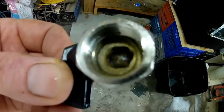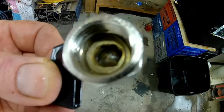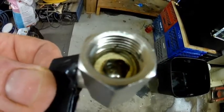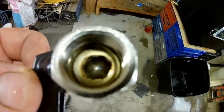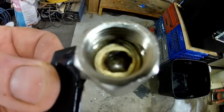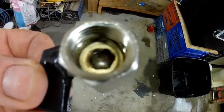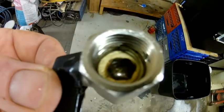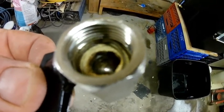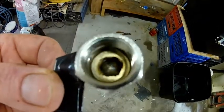And that's because of the pH of the water. The water that comes out of the freeze dryer from most foods on the pH scale is actually toward the acid side. Over the years, the water coming off the food was towards the acidic side of the pH scale, and it was corroding this ball valve over time.